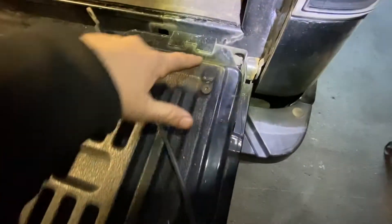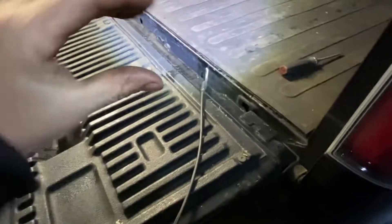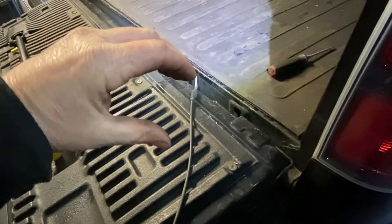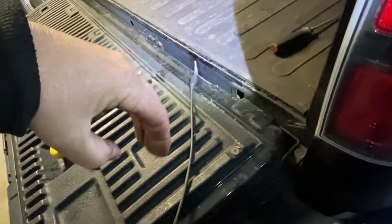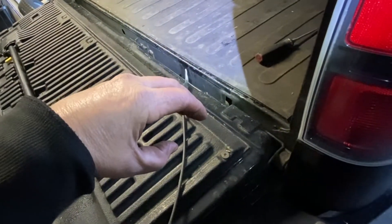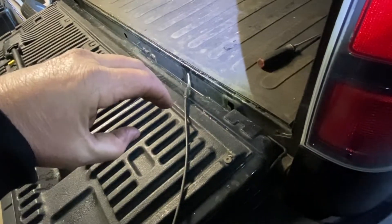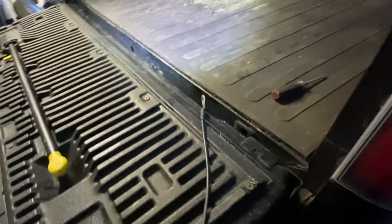Now if you're looking down here where it rides, there's a knob and it's like a circle, but when you close it, it's at a 45-degree angle. When it's closed it's all the way like that, and when it's open it's all the way like that — it can't do anything. But at a 45-degree angle it'll be able to lift up, and then you just slide it out a little bit and the whole tailgate comes off.